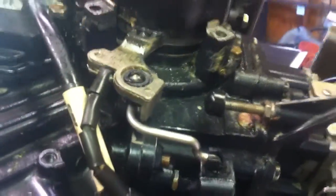Here's what the trigger, the timer, looks like. Take this off, connect this wire right here, and this wire right here. To get the timer off, just four flathead screws hold it down — one there, one there, one there, and one there — and it should lift off. Make sure you disconnect the big plugs, that one and that one. I just laid the stator off to the side because I don't need a mess of that.